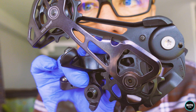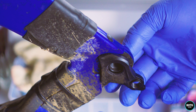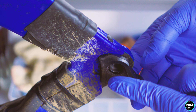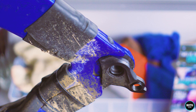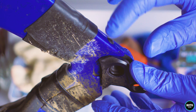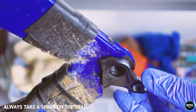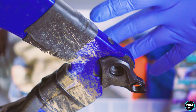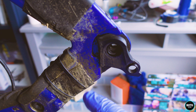With a new derailleur, you need to make sure that the rear hanger is in the correct position. As you can see, it's perfectly vertical here and touches the frame at the bottom. I have actually seen somebody online where this was twisted. The whole idea of your rear hanger is that if you get a massive impact, this whole thing can twist and it stops your derailleur getting damaged and broken — that's the whole point of this rear hanger.